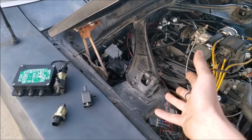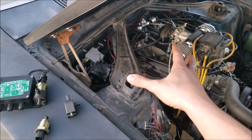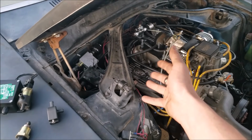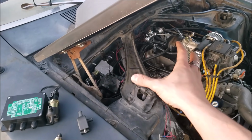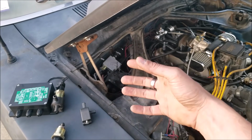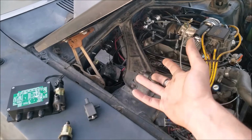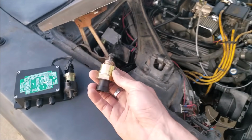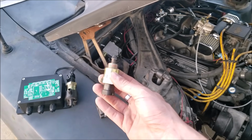You guys asked in the last video how I'm controlling air-fuel ratio on this carb, a carb being an otherwise static metering device, and then you can see on my app that I have variable control based on engine feedback parameters that I can trim that air-fuel ratio. How am I doing this? And it's so simple, it'll actually make you mad. It's nothing more than a controlled vacuum leak.